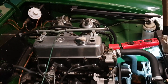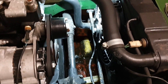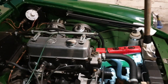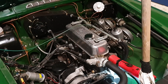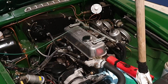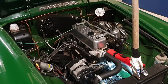So I think what it'll be is: take the alternator off, coolant sensor - I've just dropped that bottom hose. The hose, carbs, and manifold off, then the heater hose, various cables, throttle, choke and heater controls. Rocker cover off, rockers off, push rods out, and then we should be good to take the head off. So compared to, for example, that 207 I did, this should be easy.